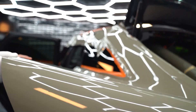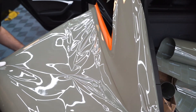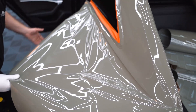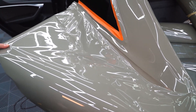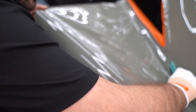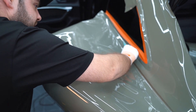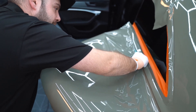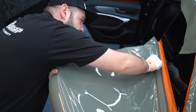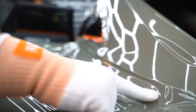We're going to have to lift it all the way back, pass our finger on the contour first. I'll peel a little bit more of the liner and get the squeegee. You come from one side, don't force the vinyl — keep it, lift it, and go bit by bit inside so you don't force it. I know a lot of guys have had issues with this recess. Just take the vinyl slowly, slowly inside.